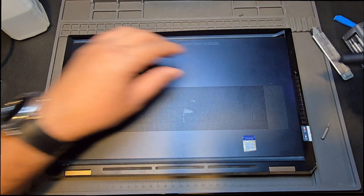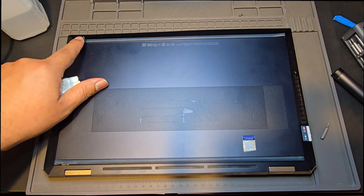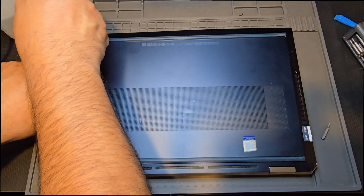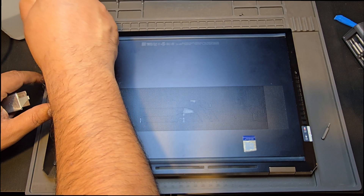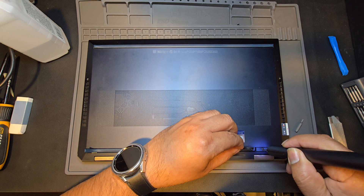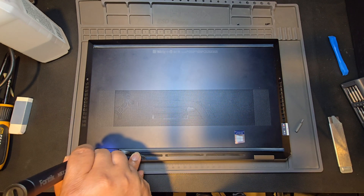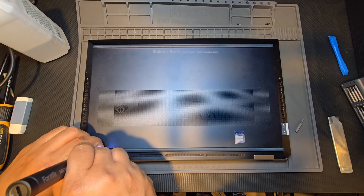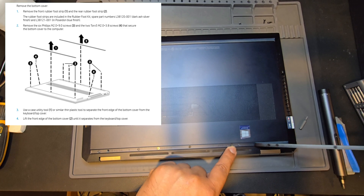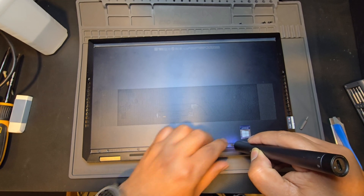There's a lot of pressure on that. All we want to do is expose that screw — you don't have to take the whole thing off. We'll try to re-glue it; if we can't re-glue it, we'll remove it all for the customer. There's a screw there and another screw there, so we're going to have to just remove this whole bottom one out. That's why you don't want to pry with force — you pry carefully. If you feel something hanging, you stop and re-evaluate it.